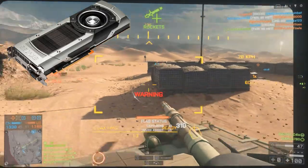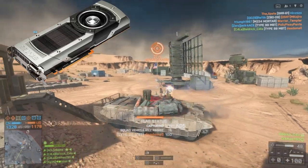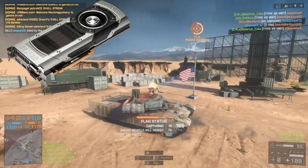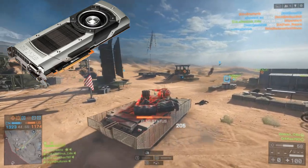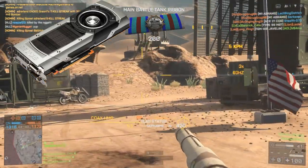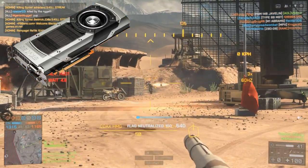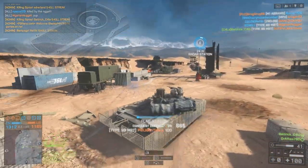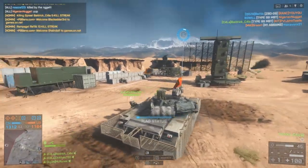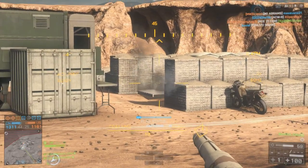On the top left hand side you will see a blower style cooler — more specifically a reference GTX 780 using a blower cooler. These have some pros and cons. The first consideration is that they're usually the cheapest type of graphics card you can buy, because they're usually reference models. They do a decent cooling job, and another benefit is that they exhaust air out the back of the card. The blower style cooler sucks air in and blows it out the back, so it doesn't have as much hot air going into your case.